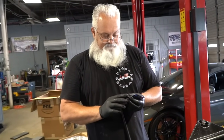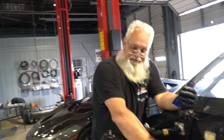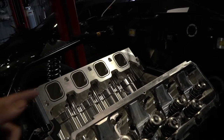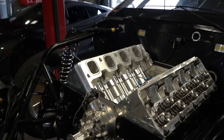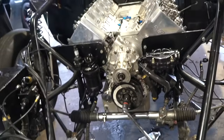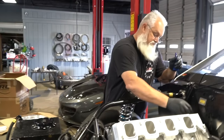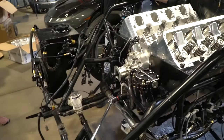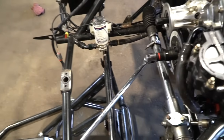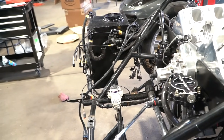Scott, how's your balloon knot? 110 foot-pound head bolts — you got a good laugh watching me do some on this side. Watching your vibrating hand and arm trying to get to 110 is pretty good. Heads are going back on, everything is looking good. I'm going to put the studs in it and we'll get the headers back on. Jose just called me — the turbos are shipping out, so we should have turbos. My biggest concern is going to be the oil scavenge. Once we get the oil scavenge and all that stuff situated — we'll figure it out. We're just going to move it back, shorten the line, recrimp it, and we should be good to go.